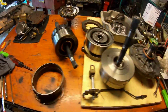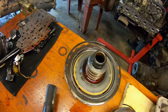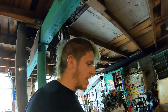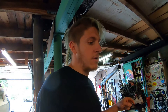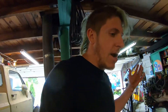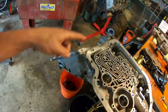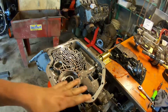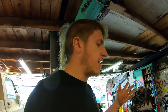We've got everything out from the inside — all the clutch assemblies. I don't see anything visibly wrong. From the amount of wear in the check ball pockets, I have a suspicion that either this is a higher mileage transmission from another vehicle, or this is not the original gauge cluster or something like that. Either way, it doesn't matter — I don't see anything obviously wrong. There's still a lot of filth, so I'm going to get this in the parts washer, get it all cleaned up, then go through the clutch packs, check all my thrust washers, install all new seals, and get started putting the shift kit into this thing.